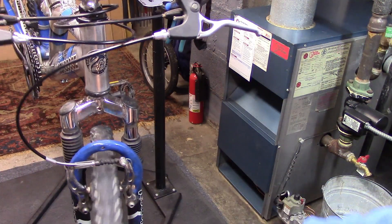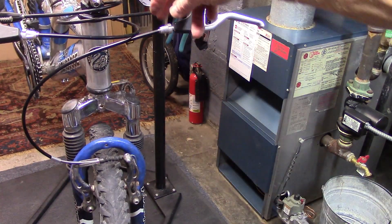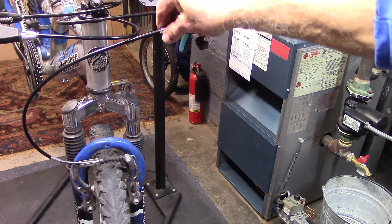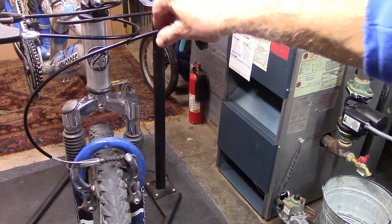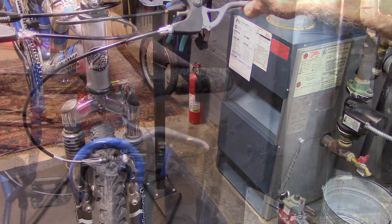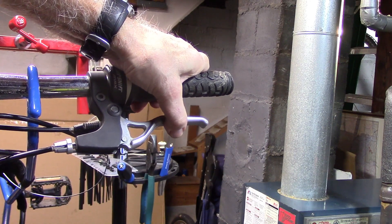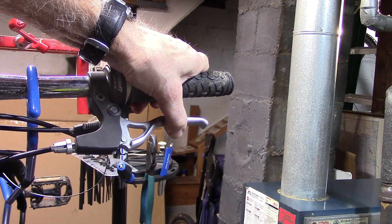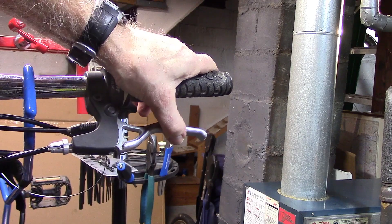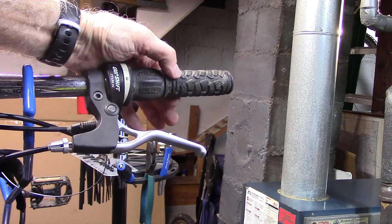At this point it looks like the brake pads are rubbing on both sides of the rim, so let's take our barrel adjuster and turn it in — that is clockwise — to give us a little more room between the brake pad and the rim. Now we get a nice rotation. The idea is to keep adjusting until when we pull about halfway back, the pads will engage the rim. If it engages too soon, we'll have a sudden brake and go over the handlebars; if it pulls back all the way to the handlebar, we won't get enough braking power.